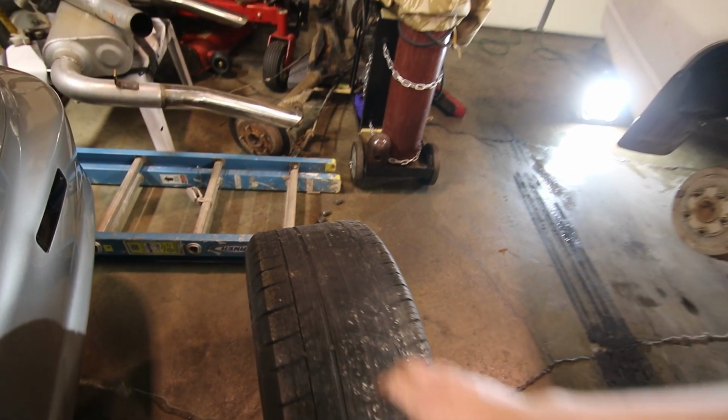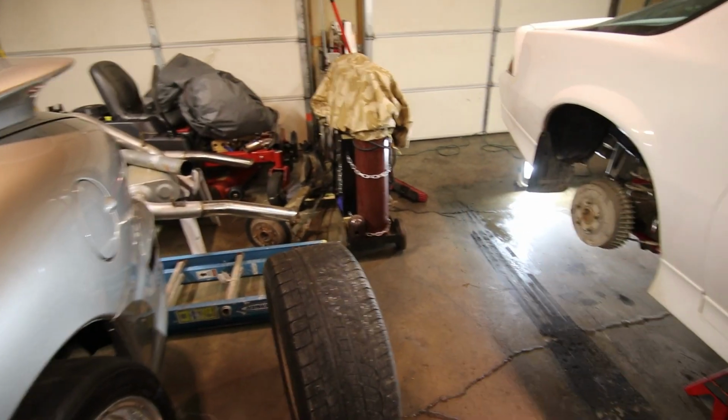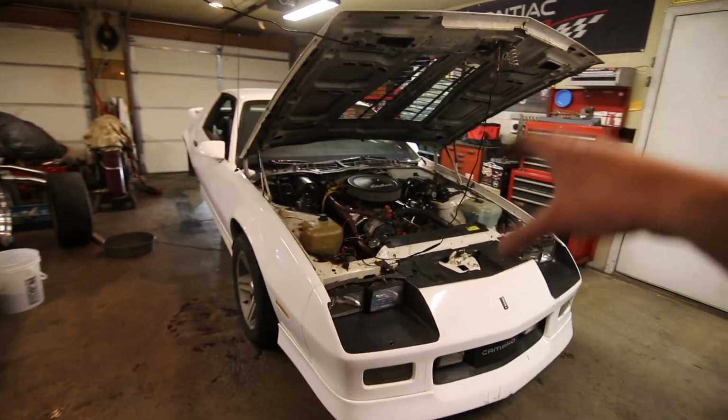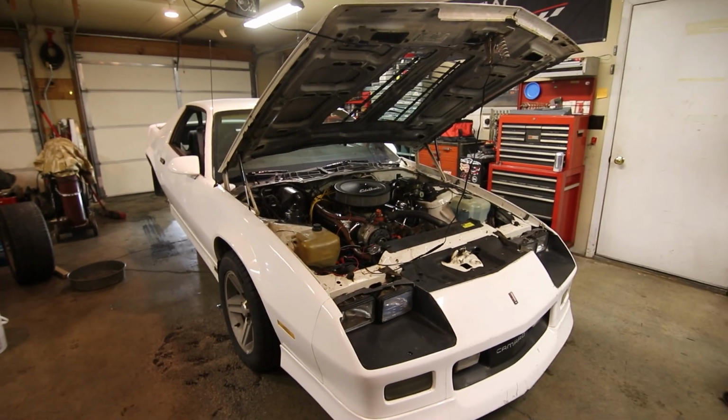Otherwise, it may mean that I just need to get a new tire and stud it at the end of the day. But this one's almost out of tread. You can't stud something that's that low. It just doesn't work. You need good tread on them because they actually sit in the tread of the tire. So there's a couple ways we can do it, but regardless, we're gonna find a way to get out on the ice, whether it be with chains or just on the tires. Should be good to go for tomorrow. So we'll see you guys in the morning.